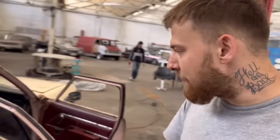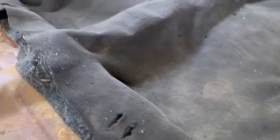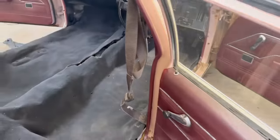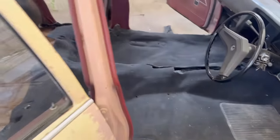You wouldn't read about it - the carpet fits, sort of, kind of. Anyway it's in there. It looks a bit dirty but that will clean up killer. I've had to cut it in the middle - I'll probably re-cut it down the middle and butt up the two joins and glue it. Put a few things on, put the scuff panels in to hold the carpet in place, then vacuum it. As soon as that seat's bolted in it'll be 100 times better.